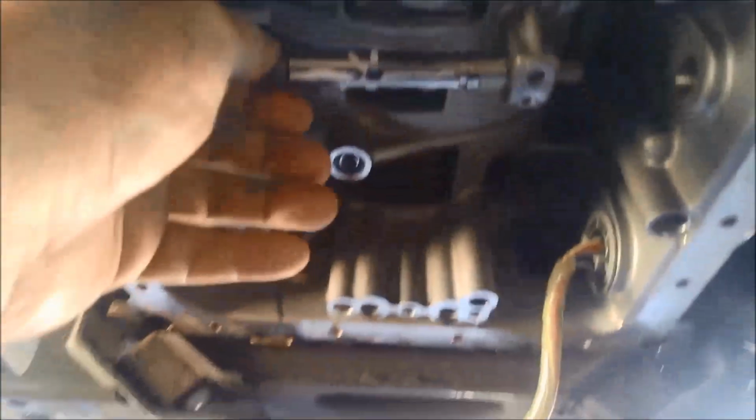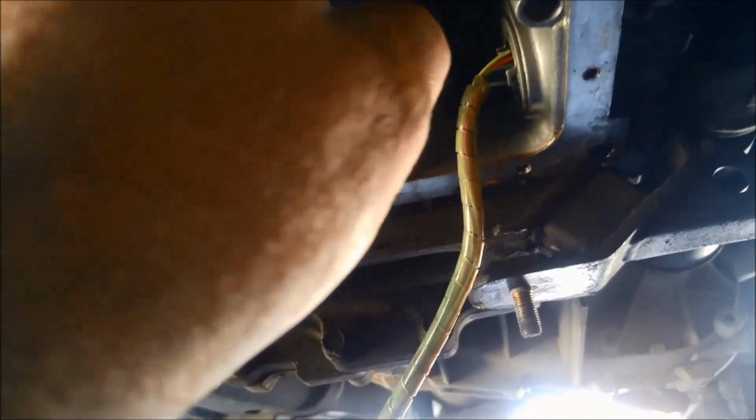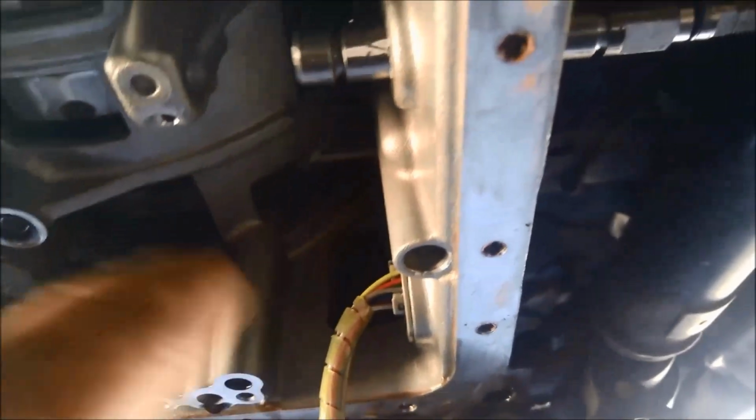And I've taken the O-ring off, and I'll push it right in, and put that O-ring in, and then I've got to put that linkage back in, and the parking pawl. I don't know if you can see it there, but there's a little circlip on it. So I can actually take the circlip out, push it through, get the seal off from the inside, and the seal's big enough to just manoeuvre over the loom, so you don't have to unplug it up the top there.